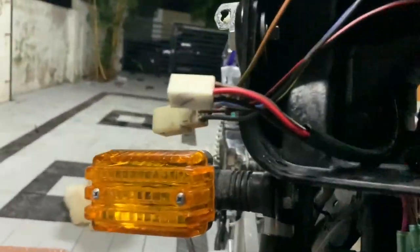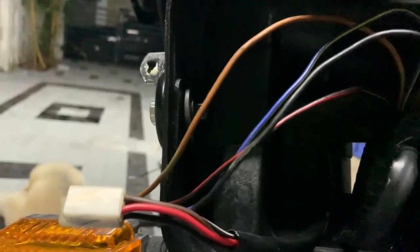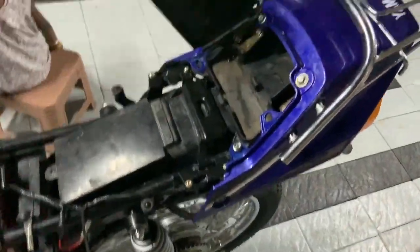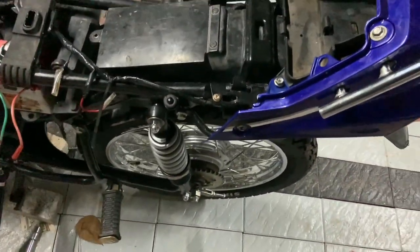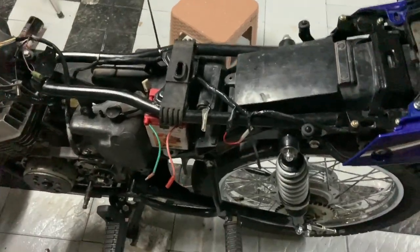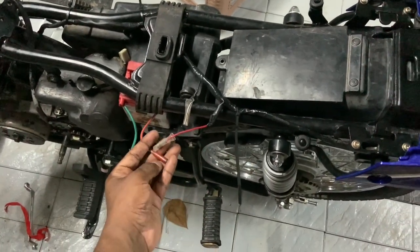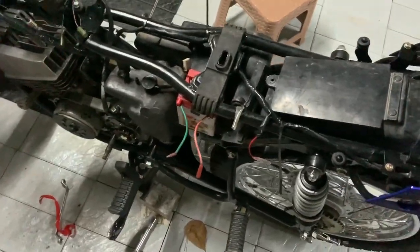The wiring has been snaked through the headlight dome. What I've done is moved the wiring loom through the hole in the bottom, and through the hole in the middle I've planned to snake all the wires coming from the top. There is that five-pin connector I was talking about - I've connected that to the tail piece. Next thing to connect is the battery. There is a fuse thing that comes here, so I have to check if I have that.